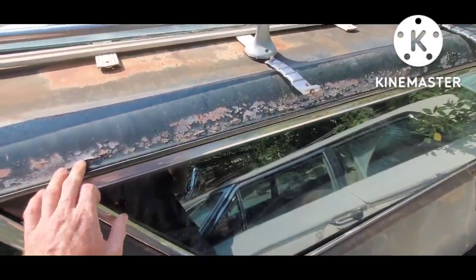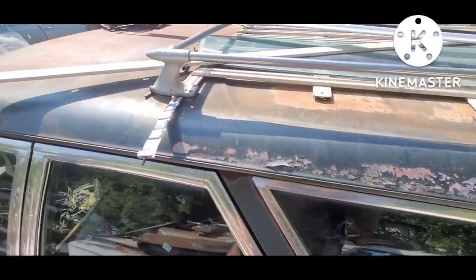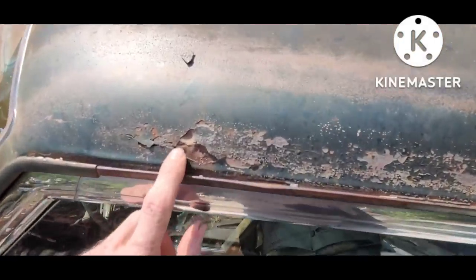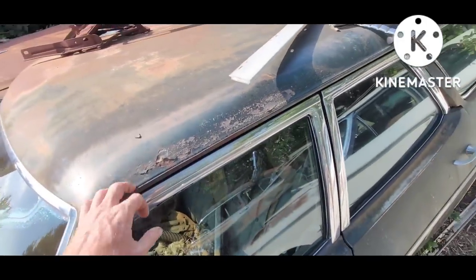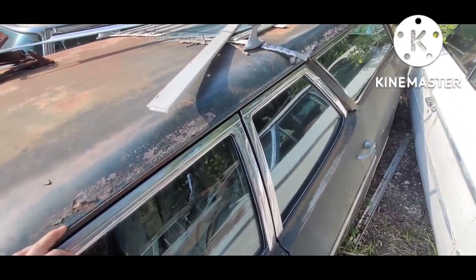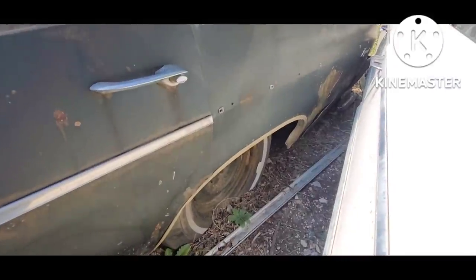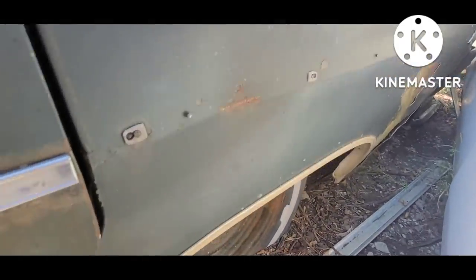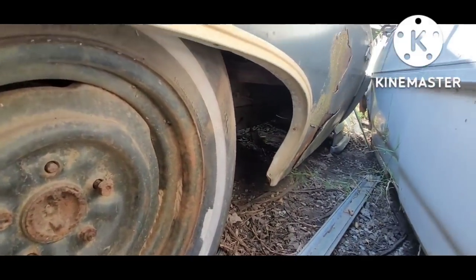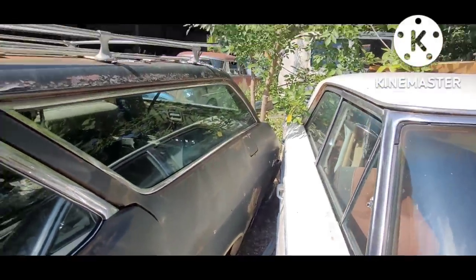Here's what I was talking about on the roof — you can see it's just covered over with body filler, which obviously is not the right way to fix it. In just a few little places there are some pinholes of rust, which aren't terribly hard to fix — just roll a patch in there and get it put back right. Over on the passenger side this quarter panel has similar issues going on, like the driver's side does. You can kind of see the bondo patches they've put back in. So it's just needing some work, attention, and help on that quarter.